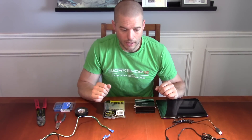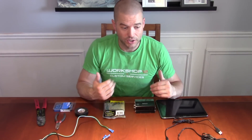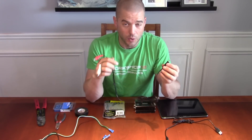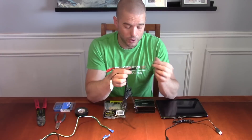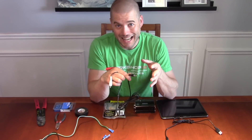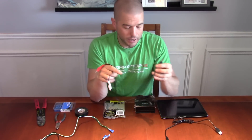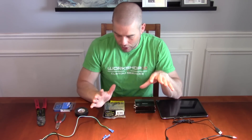That's essentially what you need for parts and wires — I'll list everything on the blog and on our product pages. One other optional item you might need is a ground loop isolator for sound. It plugs in between your tablet and your amplifier. My car had a lot of ground loop noise coming across the audio. It cleans up any noise before it reaches the amplifier. I needed it because of really bad distortion coming through the headphone jack. You won't really know if you need it until you've plugged in your audio and tried it out.